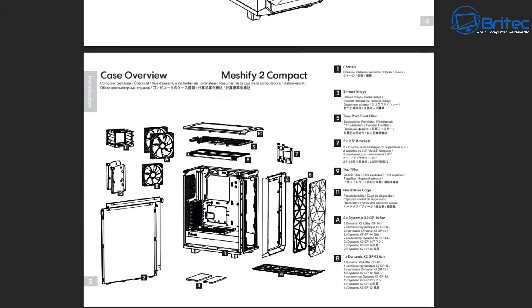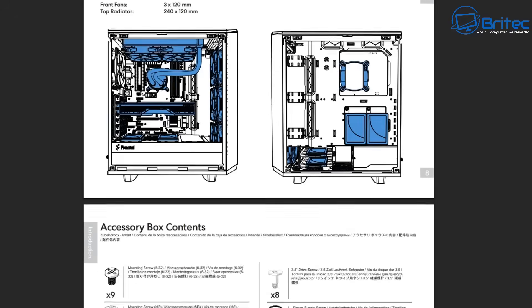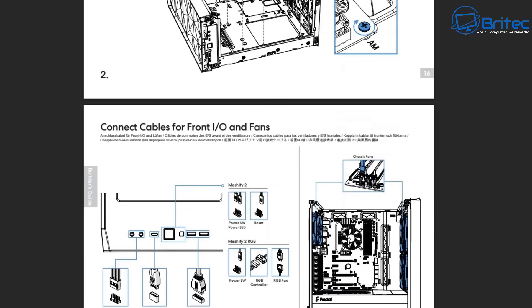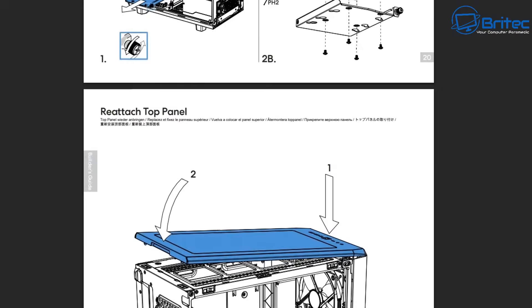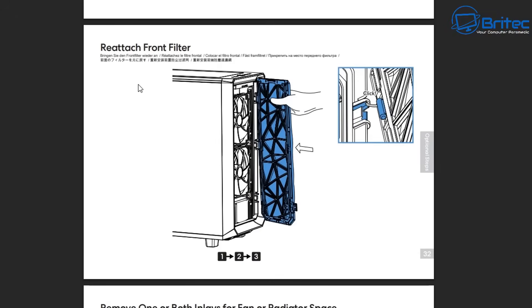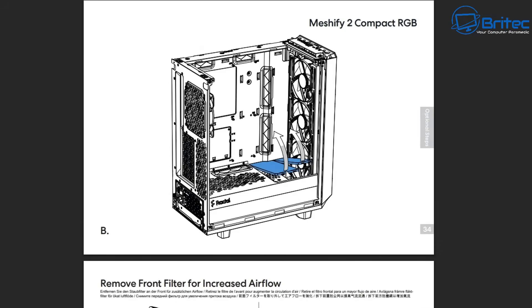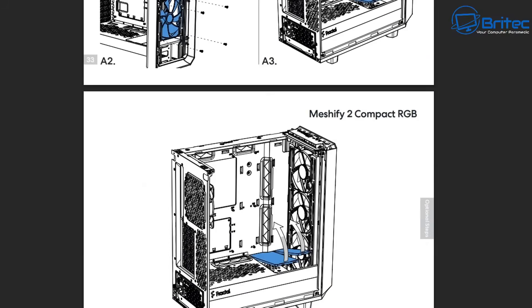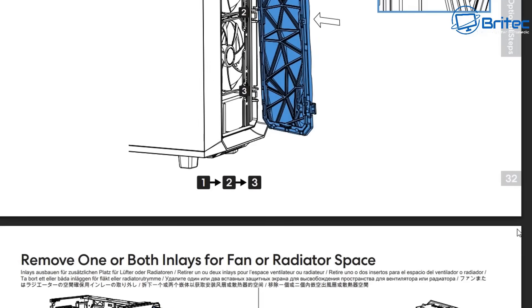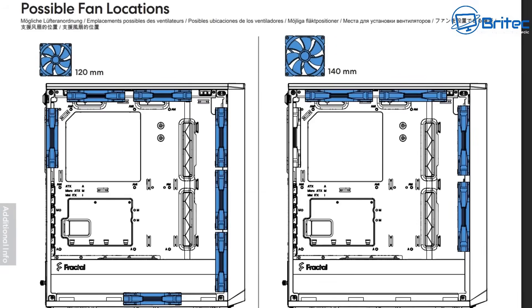You can also see the GPU maximum length. If you're buying a bigger GPU and then start putting the front radiator in, that's going to push — especially if you have an extra fat radiator with fatter fans. You have to take into account the length of your GPU because it might not fit in the case once you've put a radiator in the front end. This is a common problem, and manufacturers need to be more clear on how much space is at the top or front and how much length is available, because radiators vary in thickness and length. It's super important that you get the right size case and the right size radiator, and always check the manufacturer's website.